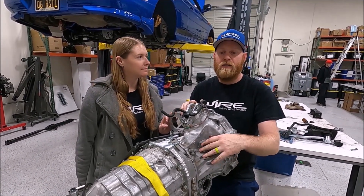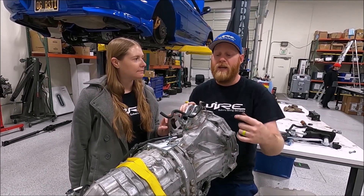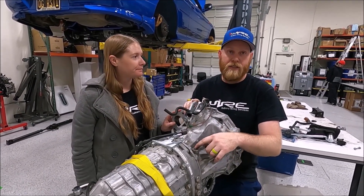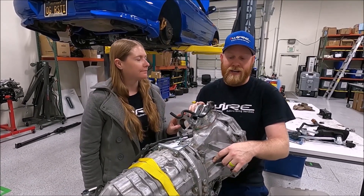When they switched to CAN bus cars, the speed information comes via the ABS unit and is all CAN-based. It's basically a digital signal instead of an actual gear with a wire going to it. So you cannot just open this up and put a sensor in there — there's no gear. You'd have to take apart the trans and add that in.